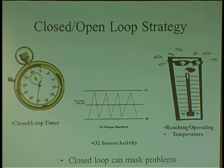If it runs better hot, it's actually adding fuel to compensate for it, because now it's in closed loop. So understand that. And here's another scenario. Car runs great cold, runs perfect cold. But once it warms up, I got all kinds of O2 codes going nuts. And meanwhile, you find out the O2 sensors were crossed. I've had many of those where the car runs great when it's cold. As soon as it goes to closed loop, that's a problem. Dude, you better be looking at O2s because it's a closed loop operation problem.